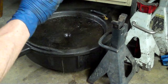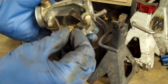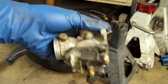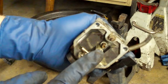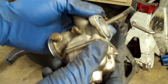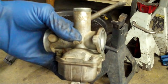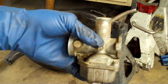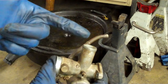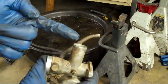Now the jets in the circuit of the carburetor work like this — it doesn't matter if it's a high performance motocross bike, though they're all fuel injected now. This is your main jet, and this is full of gas, the carburetor bowl. The way it works is the main jet works based on the Venturi principle. When you blow across the top of something, it pulls the fluid up and out of it. Like if I had a bottle and used a compressor to blow across the top, the air would go in, swirl, and pull the water out.